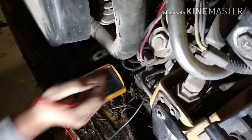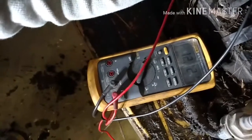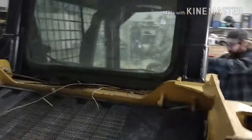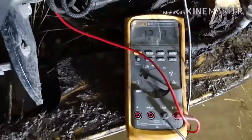We're going to set the multimeter to DC volts — black on negative, red on positive. It's a little far back there but we got it on. We're reading 12.12 volts. Now we're going to turn the key on and see what we get. My assistant is going to go turn the key — just to accessory first, the first click, which would be run.